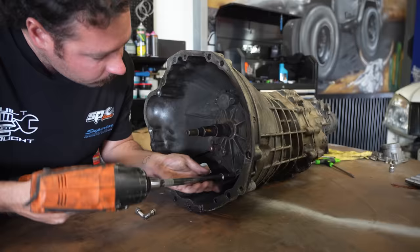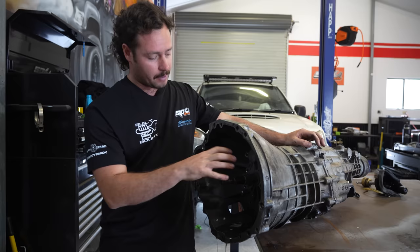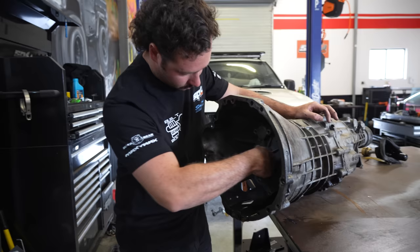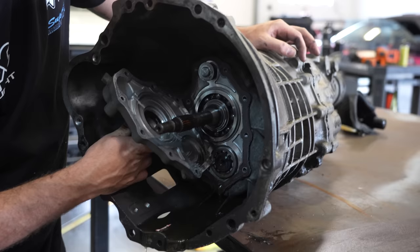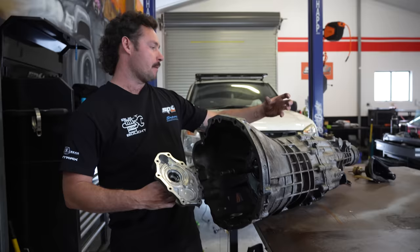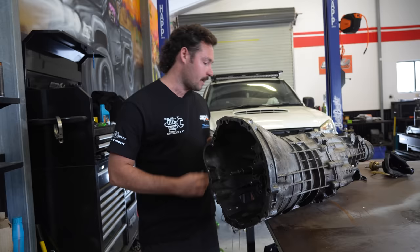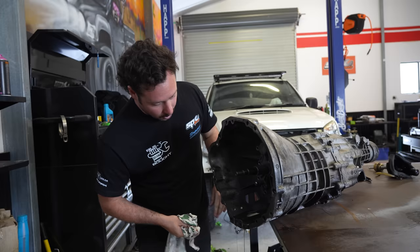Okay, hot tip number one, make sure you drain the oil. Thanks, Mitchell. So what I expect to see behind here, I've taken this cover off, there'll be basically the cover that holds the end bearings on. In here, there'll be two gear sets, so there's probably a split ring on that one, and once that's taken off, we can probably split the box and take the whole bell housing, slide that off to get access to the gears. And then, like I said, I've never done one of these before, but you probably stand that up and you can lift the whole piece out from that. So that's the input shaft. That's a common thing that breaks. That's what I snapped on my Patrol when I did a four-wheel burnout. And then that's the output shaft to the back, which normally goes into a transfer case. But because this is a drift car, it just goes straight to your drive shaft spline. So hopefully it's fairly simple, but we'll let that drain, pull these circlips off, and we should be able to get this whole casing off.